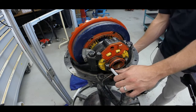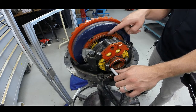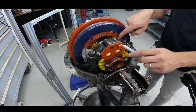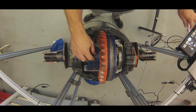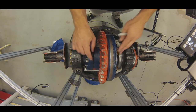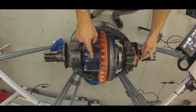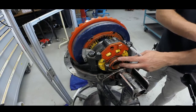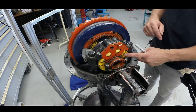The normal path of power goes from our pinion gear to our bevel gear, with the internal driving the carrier. The carrier is the same component as the differential case and so they will rotate together. All the while, the Sun is being held by the adjusting cap, or what could be called the low speed disc.